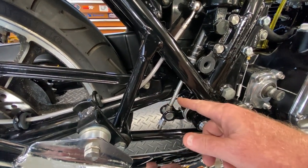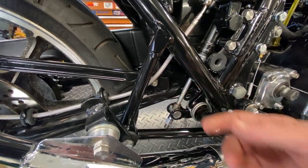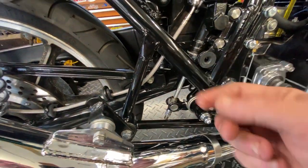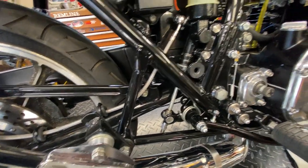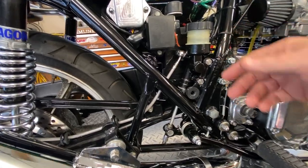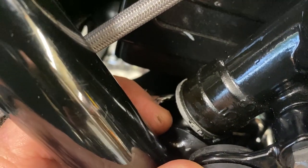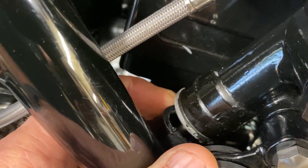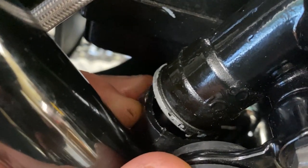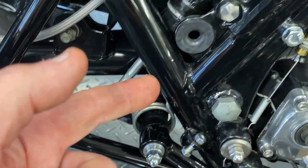Normally drips on my shaft I don't mind too much, but in this case I mind them a great deal — brake fluid, with a little puddle on the floor. It's oozing past the seal because of the condition of the inside of that bore. I can also show you this dust boot that I did replace — it's getting pretty trashed from the brake fluid. If you look down in there you can see it's all wet; it's full of fluid, capturing some of it, and it finally makes its way down.